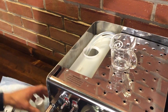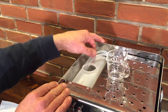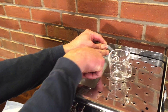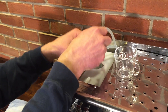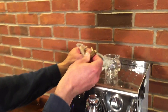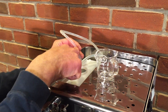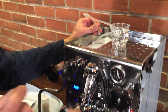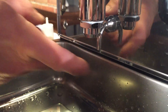You have two tubes going into the water reservoir. One, if it's a new machine, will have a water filter on the end of it — I've marked it here to make it easy to see since I don't have a filter on it. The other tube comes back from your OPV and your deaerator, and that bypasses water back to the reservoir. If you have a plumbable machine, they will come to this chrome tube down here, and you'll do all the tests at that point.